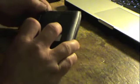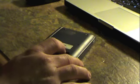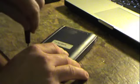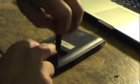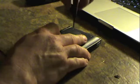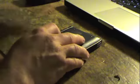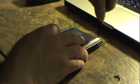One of the problems with these earlier Palms is they used volatile RAM to store data. Fortunately, the software is stored in a permanent portion. It has a modified ROM, and that contains the library software. You'll find that Telxon and other retail barcode systems like this have basically the same setup, where the custom software is loaded in a ROM chip, a customized software ROM. And a lot of times, that modified ROM will also contain additional functions that most Palms don't have.